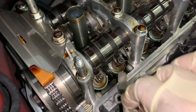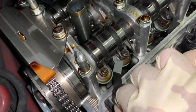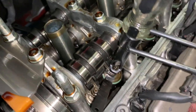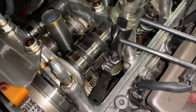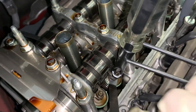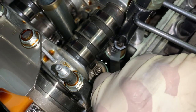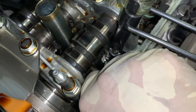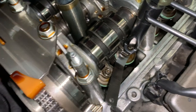This is what loose valves look like - see how there's no drag. So I adjusted this one. While I had the feeler gauge in there I was tightening: first you loosen up the lock nut, then you adjust with the built-in screwdriver, and you keep adjusting until you get the right feel - the right drag. Both intake valves are now set to spec. Good to go.